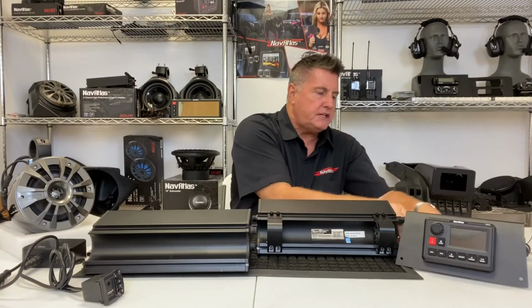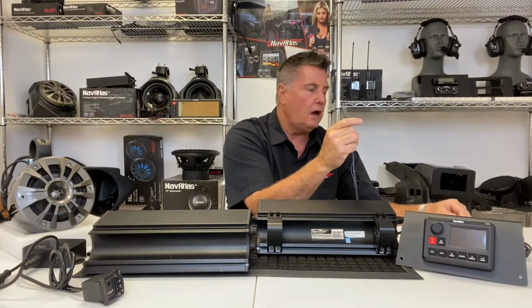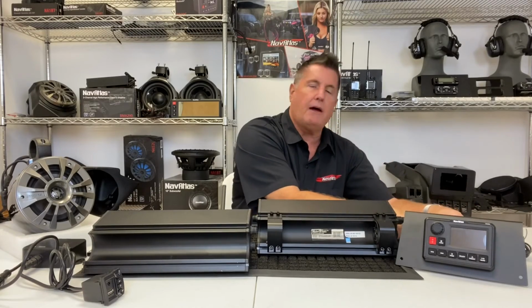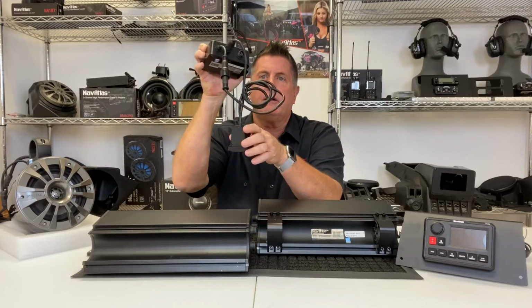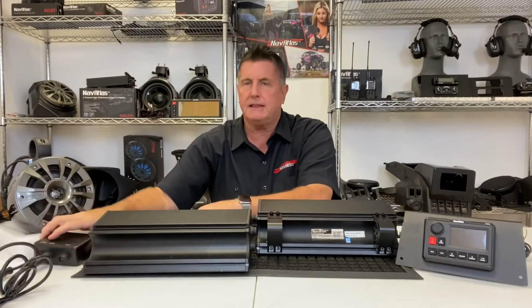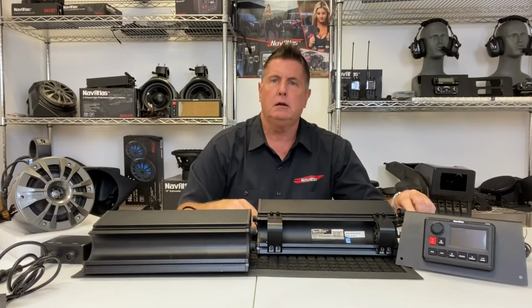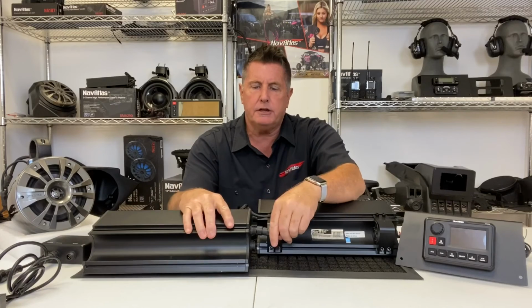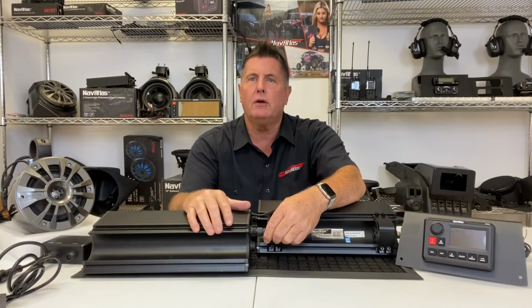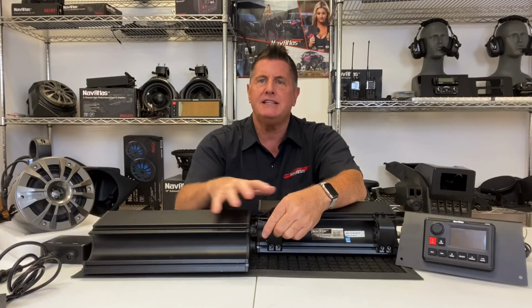either RCAing on the NA30C to the digital off the RCAs on the DIN plug to the digital out on the NA30C, or the digital processor on our Bluetooth controllers. You take the DIN plug, go from your Bluetooth controller to the side of your soundbar, to the out of your soundbar again, to the signal in on your second soundbar, and you're ready to go. That's daisy chaining on a digital platform. That's the DD cable. This has been the Navatlas daisy chaining overview.